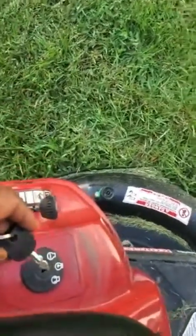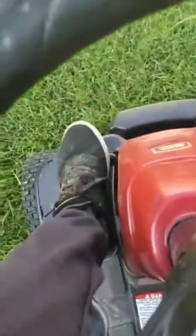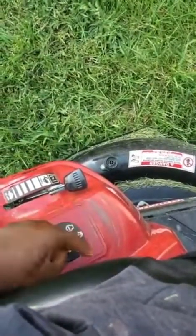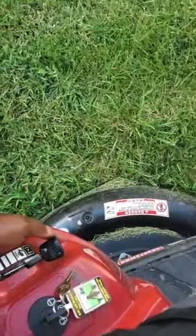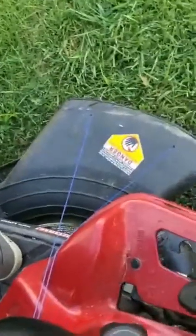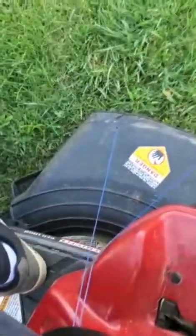So I'm going to jump on it and start it. I'll insert the key and push this all the way towards the bottom. Make sure my brake is all the way down — this is already in neutral and already disengaged — so I'm going to put this on. That's on. Now to start it, turn the key — and that's it, it has started! Once it starts, push this back — you feel that? That's full power. To engage the blade, you turn this and the blade is engaged. That's how you do it — now let's go for a ride!